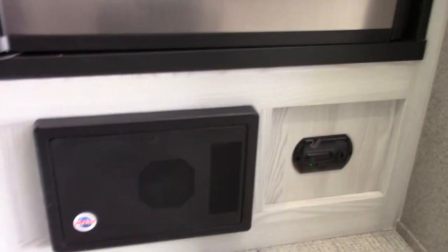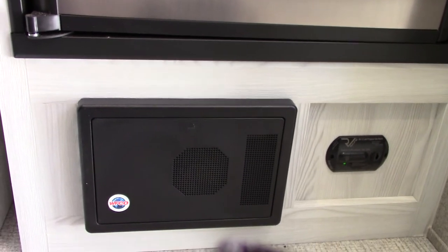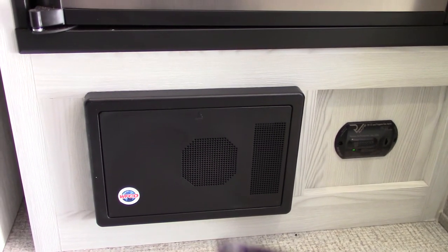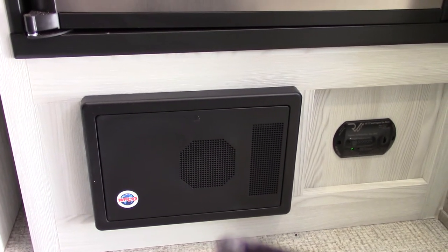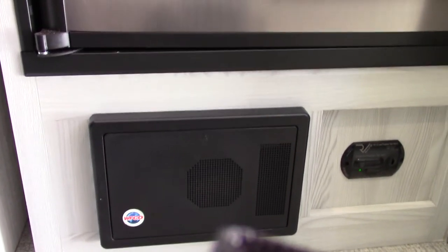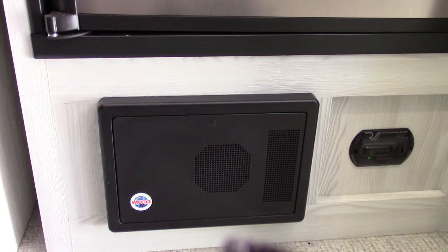If any of these fuses were to blow, they'll actually light up and you can see them through this perforation here. This is also a battery tender — as long as you're plugged into shore power, regular 110 AC, it'll sense how much energy your battery has and how much it needs, and it'll keep your batteries charged. If they're almost totally charged, it'll just trickle a couple of amps. If it's low, it'll send 10 amps or whatever is needed. So this power converter converts AC to DC power and keeps your battery charged.